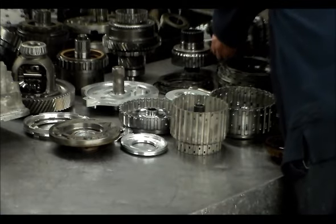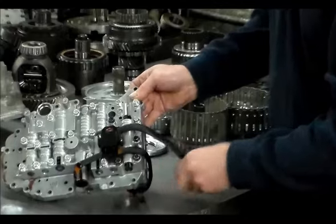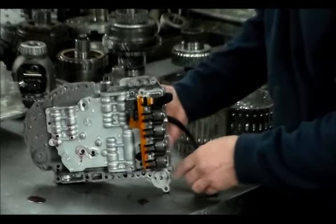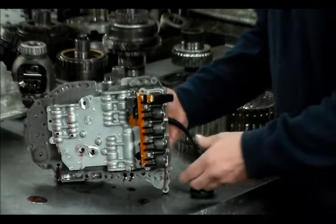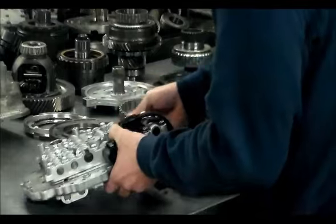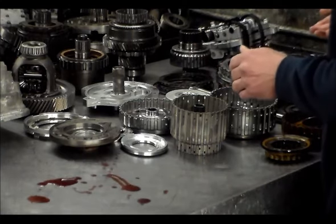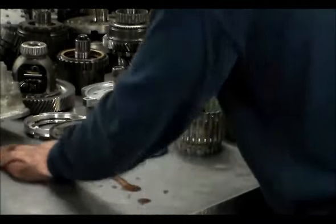All right, so let's take a look at the valve body here. This has that ribbon style harness, the one that is the problem. All right, here's all these solenoids, extra solenoid here. So you want to be very careful with this. I'm not even sure if I order that harness to change it, if that's going to be correct, because this actually is a 5-speed unit.